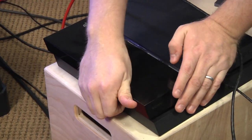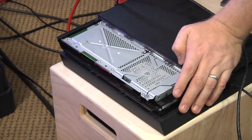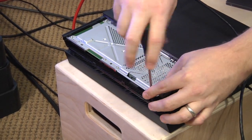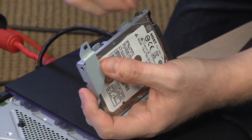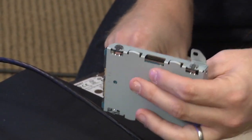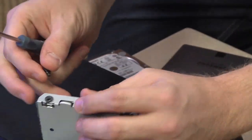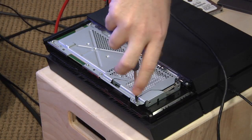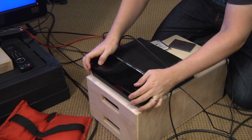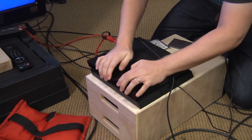The hard drive is designed to be swapped easily. All you do is pop the plastic cover off the case, unscrew one screw, pull out the drive caddy, and then remove the four screws that hold the hard drive in place. Replace those four screws, slide it back into its slot, screw it back in place, and put the cover back on. It's really important to put the cover back on because that controls airflow on that part of the PS4, and you don't want to leave it off or you'll probably overheat.